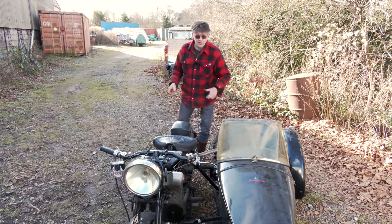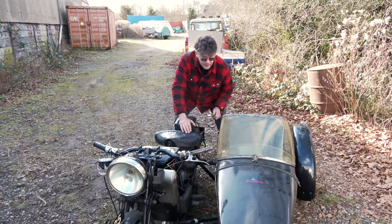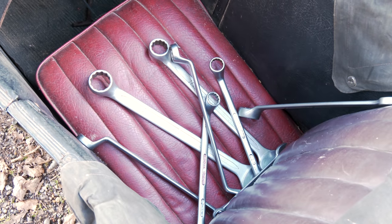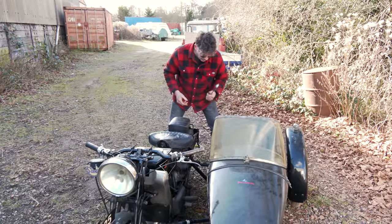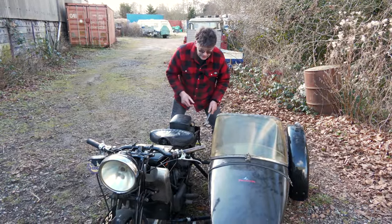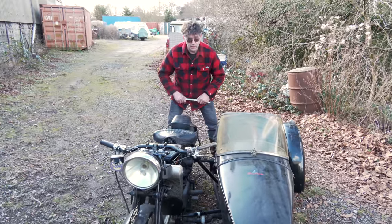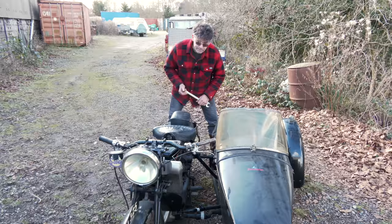So I'm going to take the chair off now. Bearing in mind, old British bike — always make sure you've got the right tools. Whitworth spanners — something like this is 5/8 Whitworth, big spanner, combination. So we're under the back nut here and we just work through it. Don't try to do it with AF spanners — you can get these Whitworth spanners, they're quite available through the right channels.